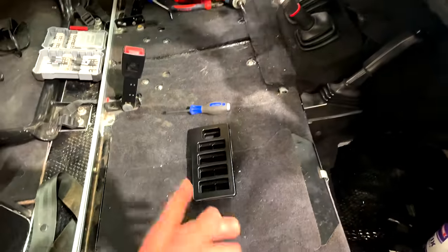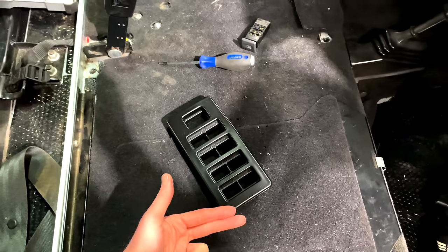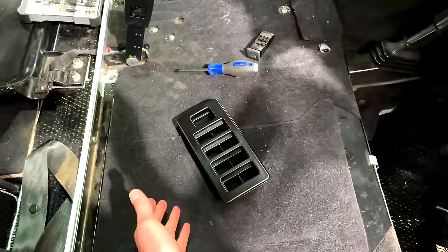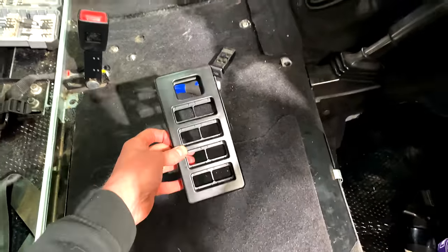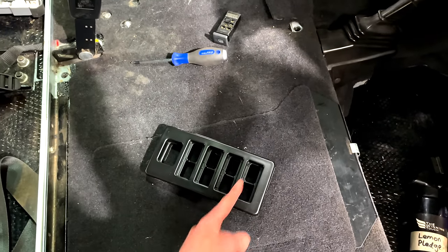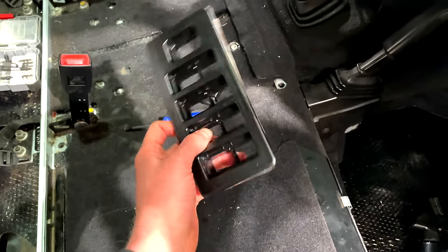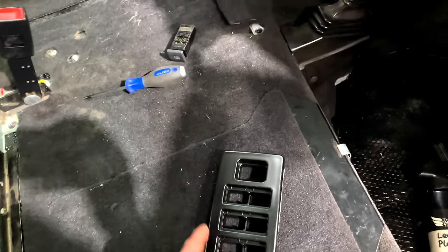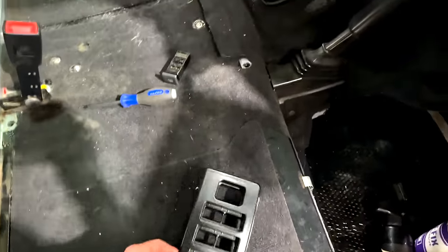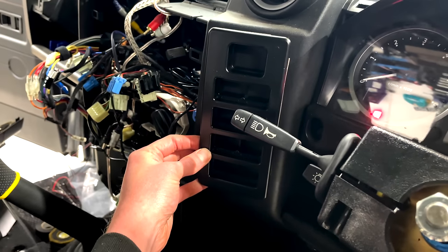Okay, so basically with these side panels, they usually have the big sort of 52mm hole for a rev counter or something, which some people leave blank. We like to cut them down. The later versions of these, they've started supplying more switch blanks, which is more usable, which is fantastic. The only thing is, if they're not all filled out, then it looks pretty stupid unless you've got the blanks in there, but it's a little bit too much. So we're just counting how many switches we're going to require, and then what we intend to do is either cut that down there or down here, and we're left with this little mini switch panel, and we don't have this kind of excess look to it. A little switch panel that's only that size looks a bit more factory, but basically we're going to have to modify it, cut it, paint it, and then we're cutting a smaller hole, but it looks a bit more factory than, it looks a little bit over the top, if I'm honest.